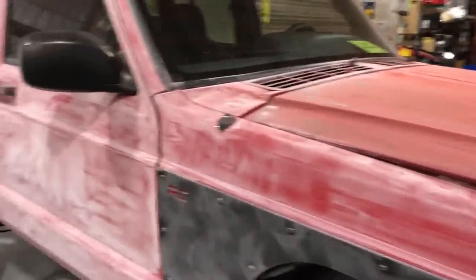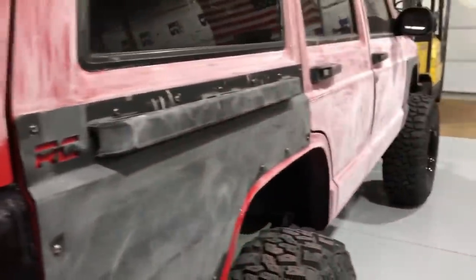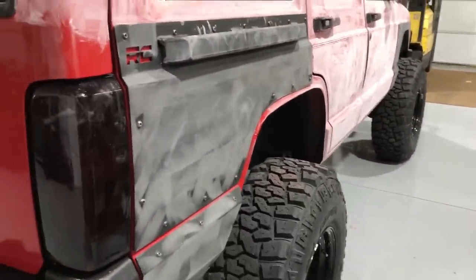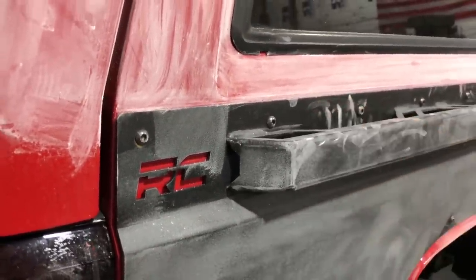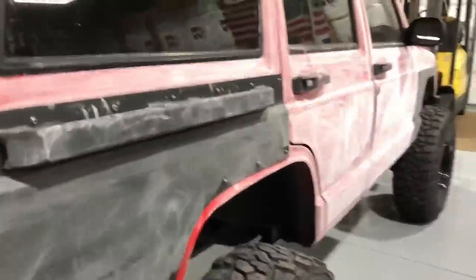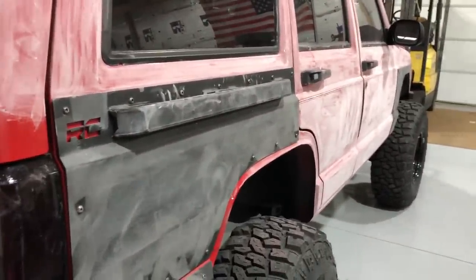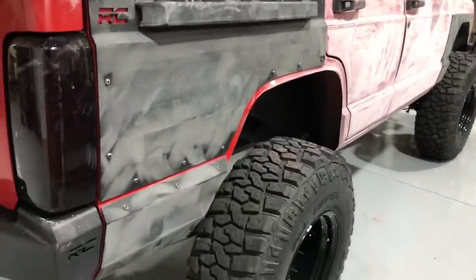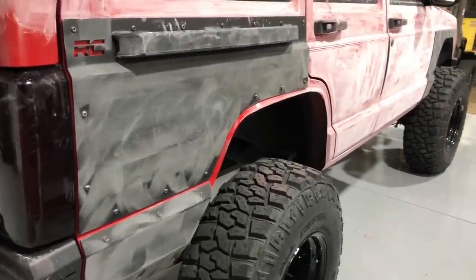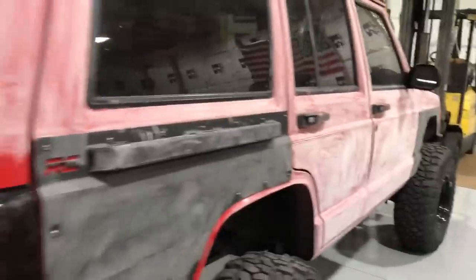So yeah, I'm gonna spray the whole truck in a bed liner. I got two kits because I think it's about twice the size of a full size bed. These bolt on panels still have a rough texture, but in the beginning stages, it was washed real good with Purple Power. That degreases it and takes care of any waterborne or water based dirt. And then I de-waxed it with a special solvent, like Prepsol. And then you sand it, or else that'll cause problems.